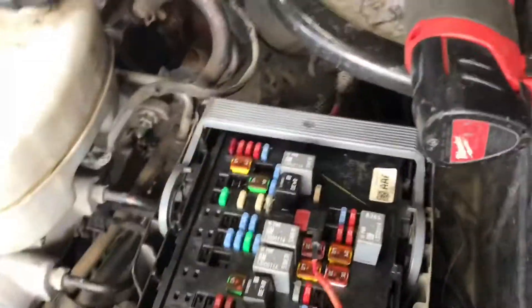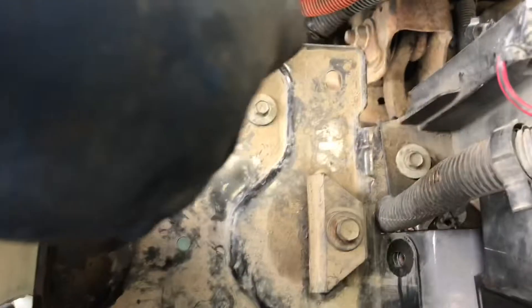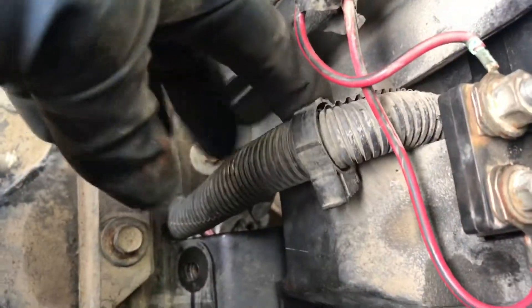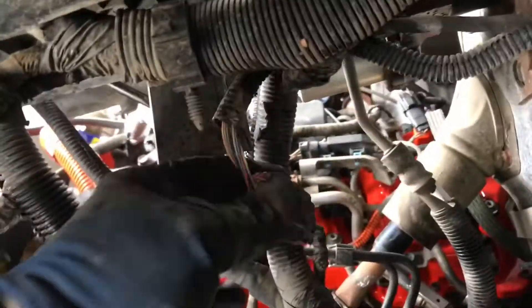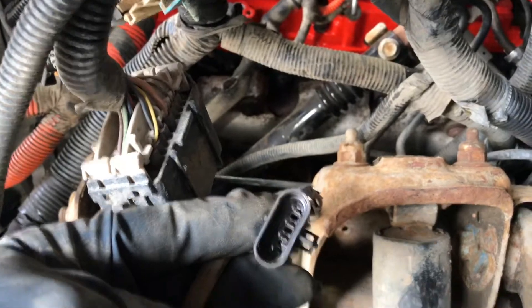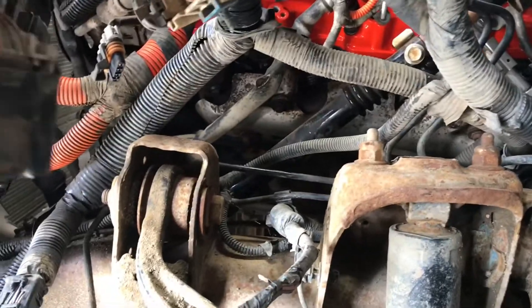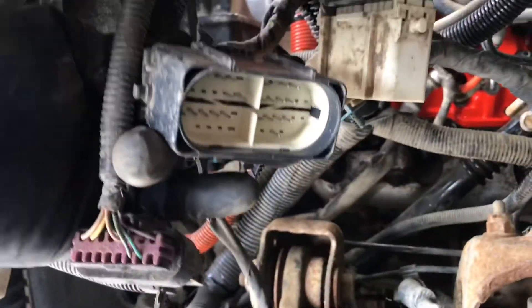Got that all back in there — wires plugged in, plugged in the wire for the brake controller. Putting the battery box back in, lacking one bolt — going to go find that. There's a little wire snap holder that sits over there, then transfer down here in the wheel well. There's a purple wire here that goes into the harness; all this is going to go into the fender well yet. There's a vent line here and a four-wire plug.